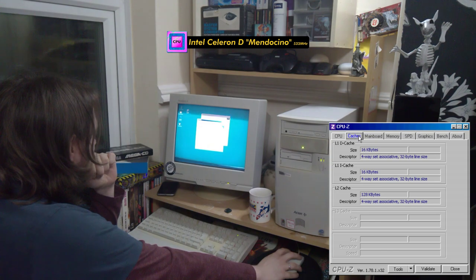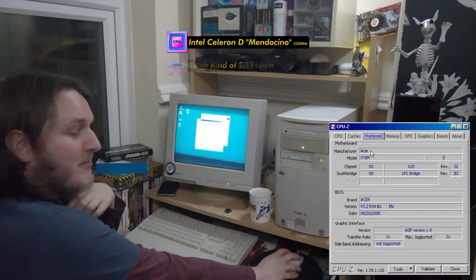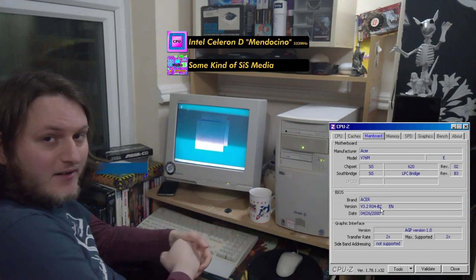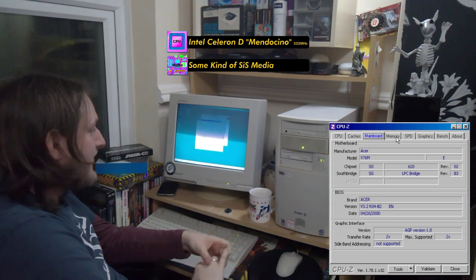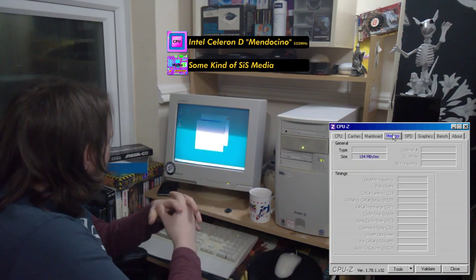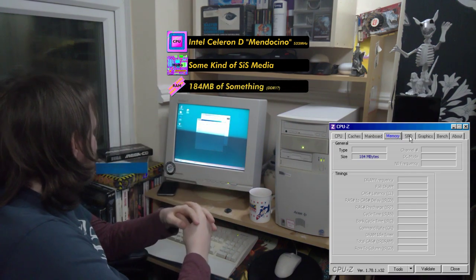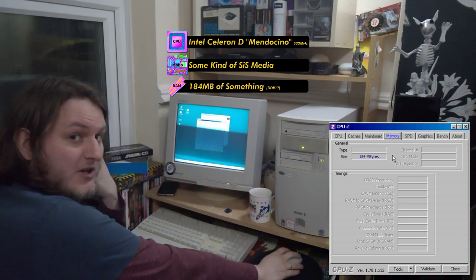We also have some sort of motherboard made by SiS, who have annoyed me on multiple occasions actually with older machines. The SiS chipset and the graphics chipset and things is very widely unsupported. I've had a lot of fun trying to get Linux to play ball with such installation. We have a grand total of 184 megabytes of RAM with absolutely no information about frequency, type, etc. DDR1, I assume. We'll get a better look at that when we open it up in the next video.